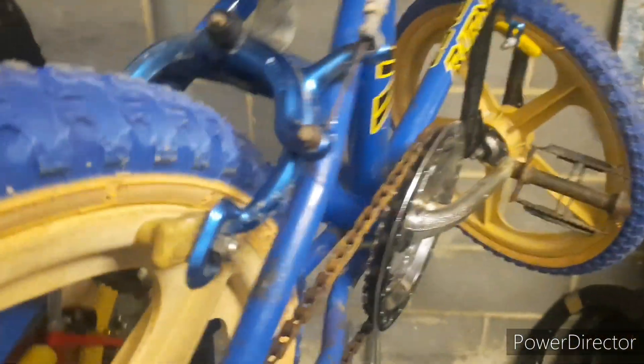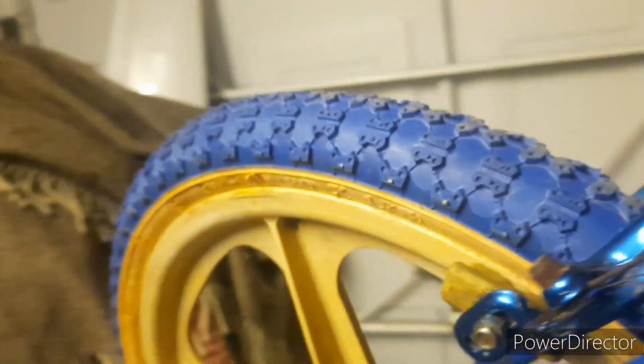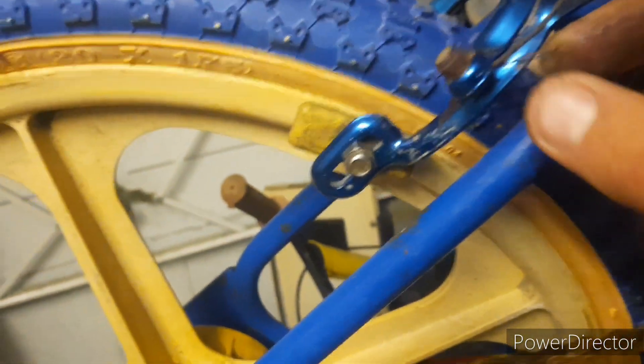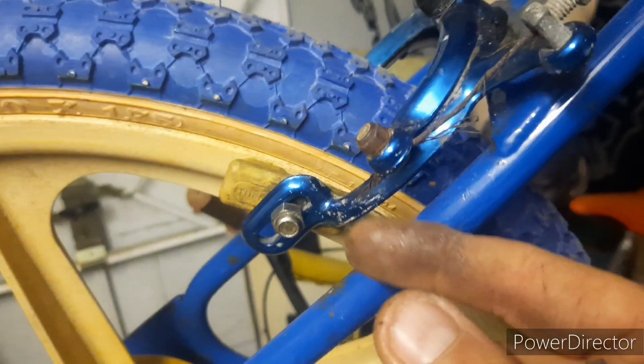The brakes will need some adjusting because it's just touching the pads. We need to get these levers coming out, so undo that nut there - that one there - undo that one, free them up and loosen them up. I think whilst I'm sorting these brakes out I'll get this caliper off and just check it over, make sure it's all right. It might need a new cable but I think the cable's okay to go again. But yeah, let's get it off. That's the original nut, bolt and washer.